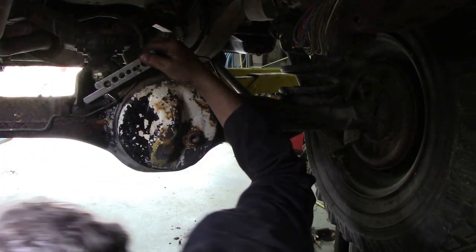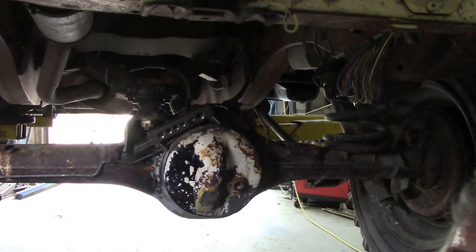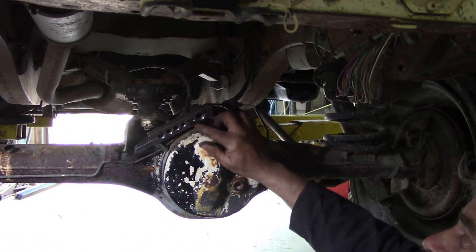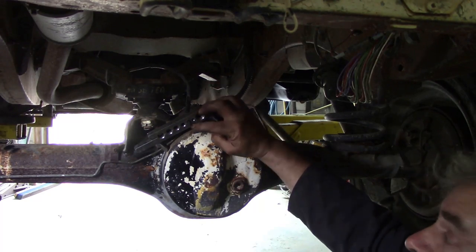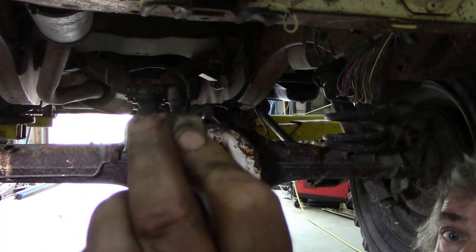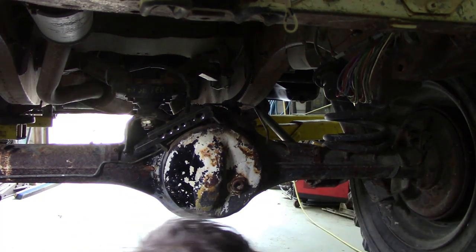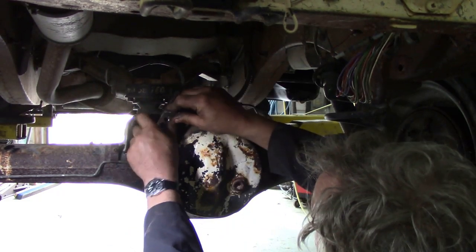To get the fitting back on, I've used one of these plumber's flaring tools - they say it's for brake pipe but it's absolutely useless for that. I've clamped the pipe in, bared back a bit of the original protection, and cut it as short as I could to the stub end of the pipe. I've put a 10mm bolt through there to protect it and stop it crushing. I'm just going to push that into there and support it.